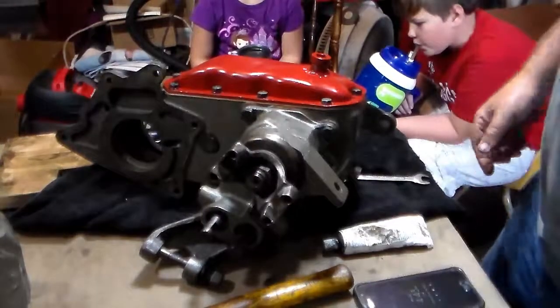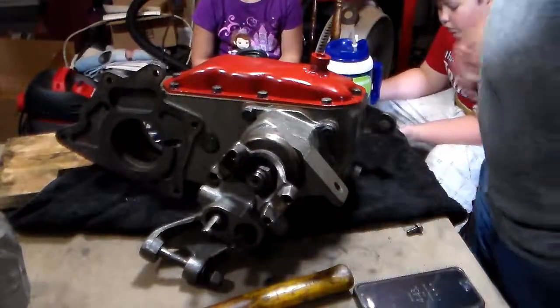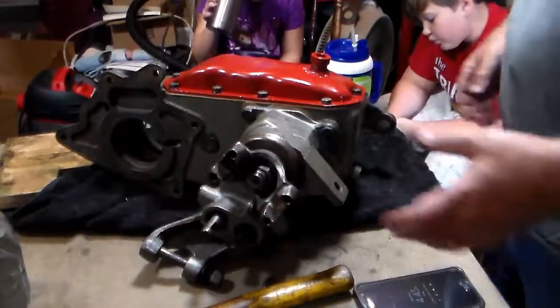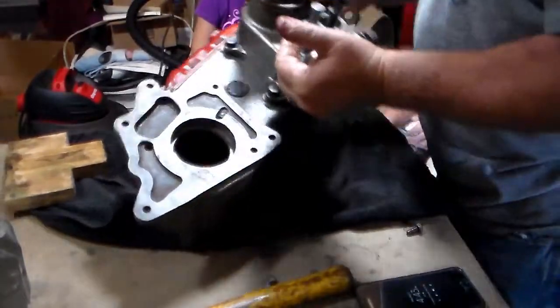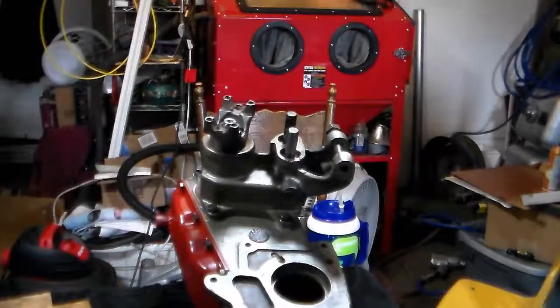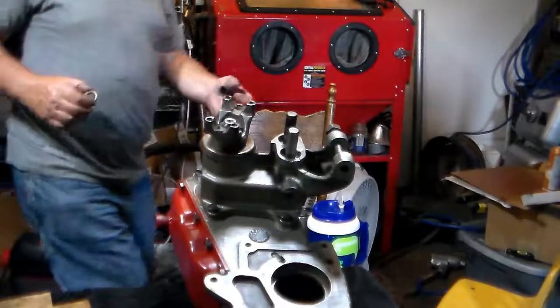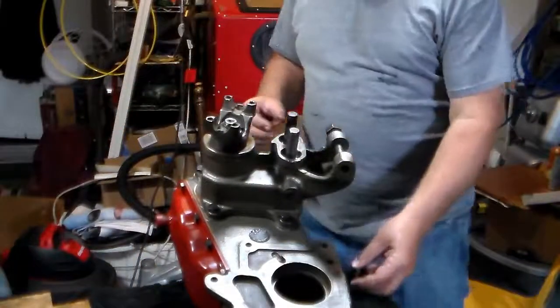Okay, and that brings us down to installing the emergency brake cable — or emergency brake assembly — which we're not doing. There are two things we've got left to do, folks. We need to install the shift rail seals. We need to find the one that's about the same size around as this is — like that one. Hopefully this will fit over the shaft, and it will, just like that. Back in here.